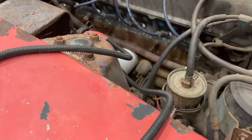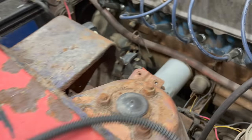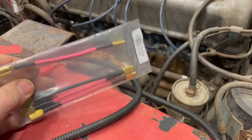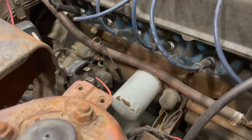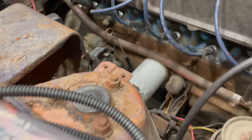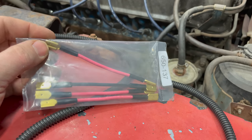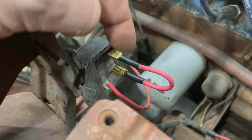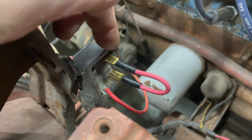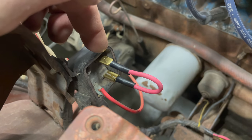I don't need my circuit breaker connected anymore. I found a kit of fusible links in the back — the different colors are different amperages, and the one I have missing should be red. I'll take one of these red fusible links and put it in there. It's pretty simple — it just loops from one terminal to the other, and then there would be an opaque white plastic cover on top so you don't get water inside.